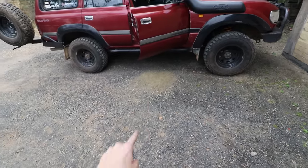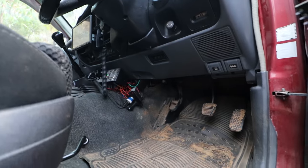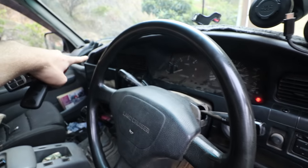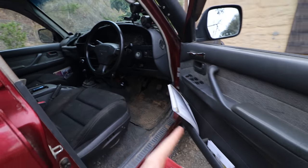A lot of the messy wiring is still from the old aftermarket security system that was already disabled. I tried to remove as much as I could, but so much of the wiring went up through the ignition barrel and must have also acted as a kill switch. I didn't want to remove the kill switch stuff in case I killed my ignition — I do need to tackle it, but today I just wasn't ready to do that much dash yoga. I'm thinking of making my own kill switch, so that could be an upcoming video. If you don't do the hazard light integration, this is super easy — literally door card off, cut some wires, splice some power, and away you go.